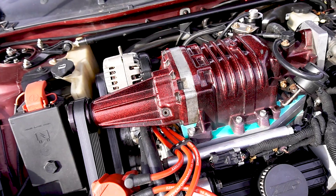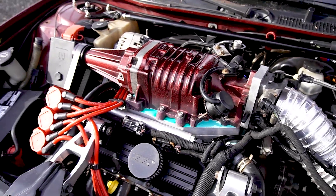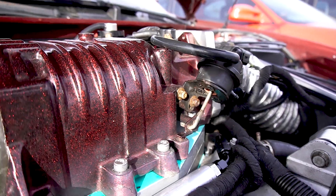There are a lot of mods you can do to it. You can put an intercooler plate underneath it, a front mount heat exchanger for air-to-water setups, and change pulley sizes. They're pretty serviceable in general. Finding things like cases and bearings may be a little more difficult, but we have many of those on our website — snout bearings, needle bearings — though rotor packs are a little harder to find.